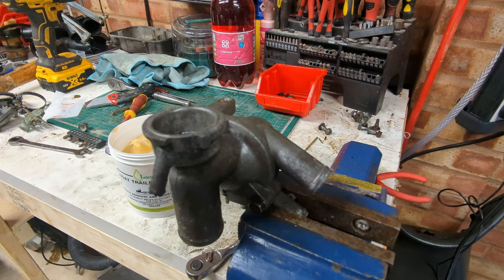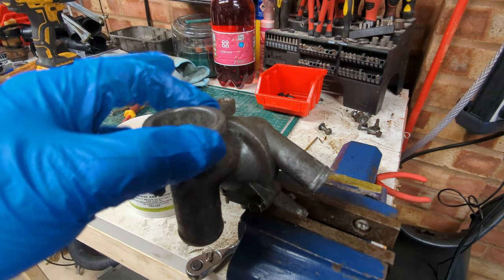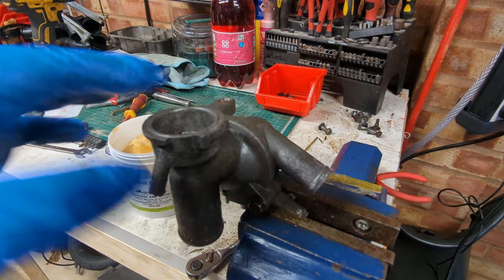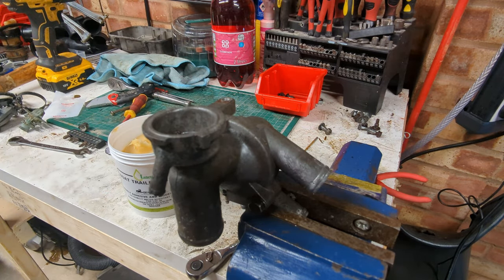Talk about the cap. I haven't bought a new one yet because they're ludicrously expensive. I'm told there are some that work for other vehicles, Honda cars, I think the Honda Accord, but I need to do a little more follow-up on that. So for the time being, I've dunked the existing one in Evapo-Rust for about a week, without the O-rings in it, of course, and it looks a bit better, so maybe we'll clean it up with a wire brush, stick it on for now. I don't expect it to hold correct pressure, and we'll sort out a new one as and when.